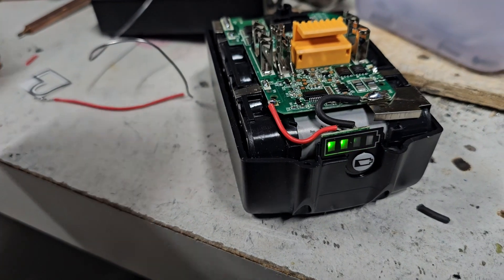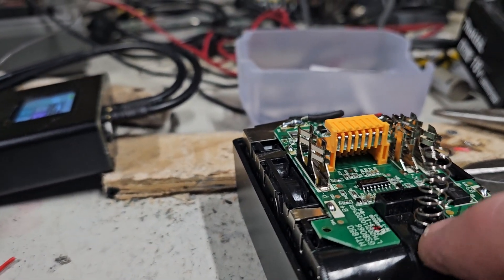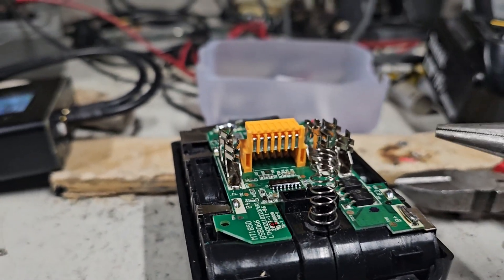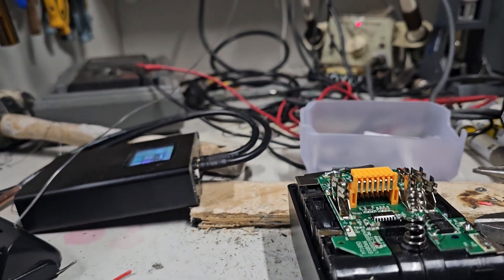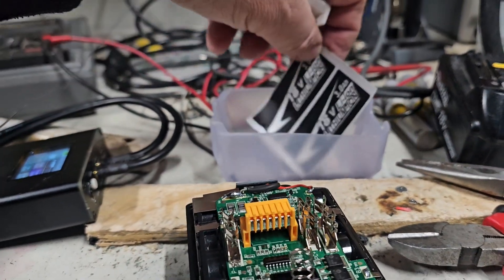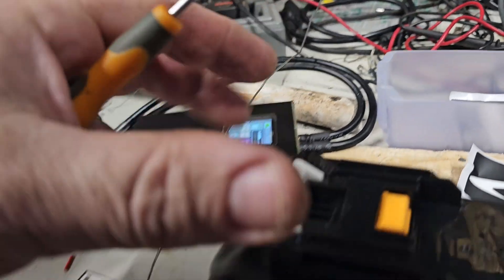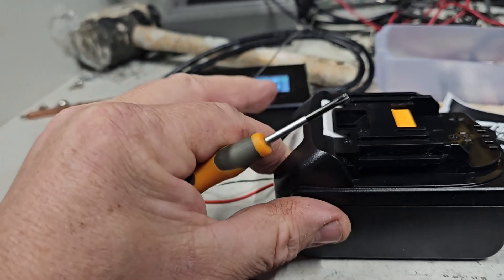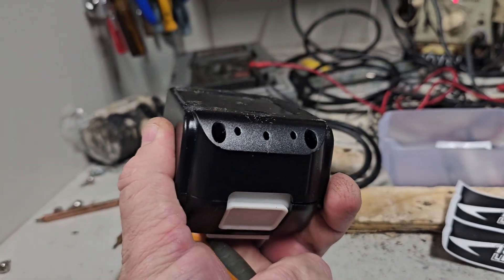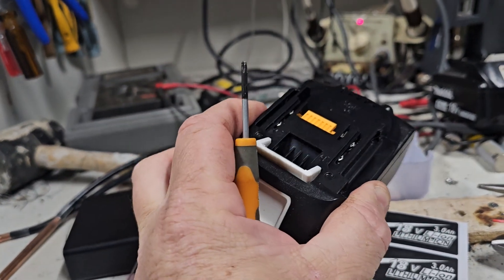If you can't get it on you're going to have to squeeze it and then use your fingers to try and push it down, because it's not perfectly set up for it. You'll need to use your fingers and squeeze it with a pair of needle-nose pliers. That's pretty much it — all you have to do then is put four screws in and you are the proud owner of a new Makita battery. Don't forget to put your stickers on. You're going to need a Torx bit — the largest one in your set — to screw the screws in. Putting the lid on is a little bit hard. The actual plastics — not sure if they're very good or not, they look alright but over time it might change. But for the price I'm pretty happy with it, and that is how it goes together.